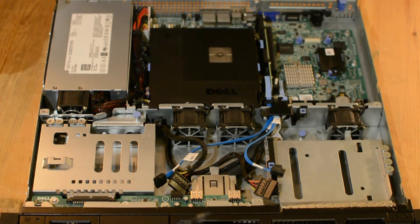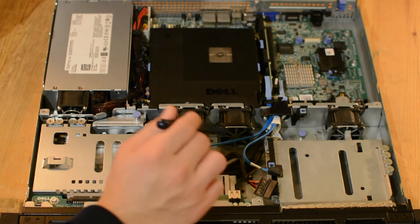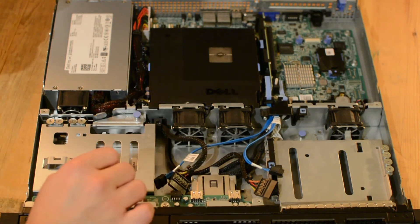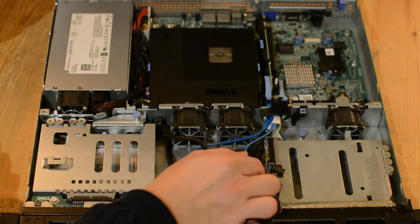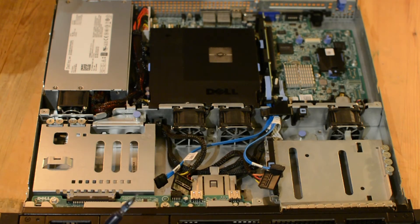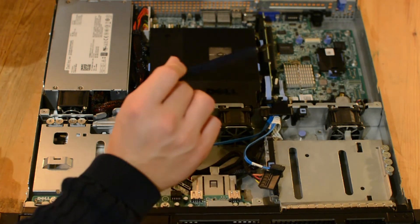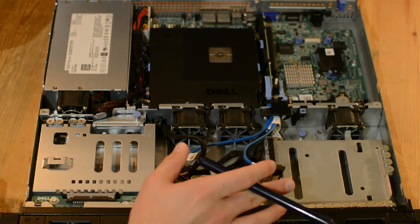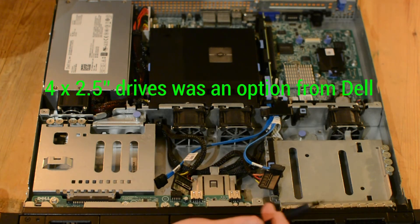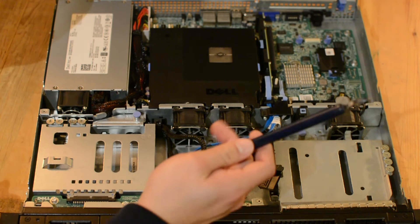This is the inside of the server. The first thing we see is the two dedicated hard drive plates — the first drive goes right in here, the second right in here. This didn't come with any mounted drives, since most people don't tend to sell their drives. It has two SATA power and data connections for the two dedicated drive spots. Interestingly, there are actually five SATA interfaces on the board, though the chassis only has two 3.5-inch drive mounting bays — perhaps intended for SSDs or it's just a generic board used for many configurations.